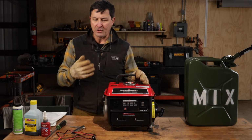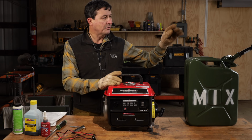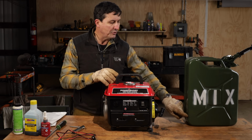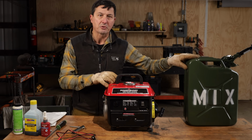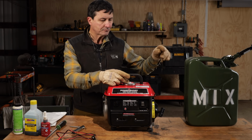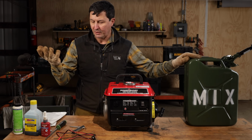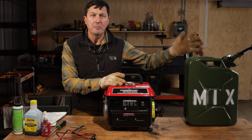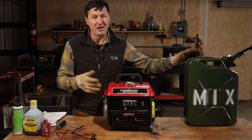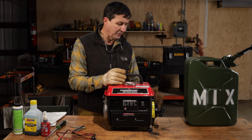What I'm actually thinking, rather than doing the kerosene heater down at the well pump when the power goes off to keep the wellhead from freezing, what I might do is take one of these Wavian cans. Maybe I'll do a video on it. I can show you how to put in a bulkhead fitting like we do in the wildland fires. We actually use similar cans to this as external cans. So what you could essentially do is tap the cap or the side of the tank and the can, and have a 5-gallon reserve tank, and that's going to run, well, 5 times, that's 25 hours. So that would basically give you a 24-hour run time on 5 gallons of gas. Not super efficient, but in an emergency, it's better to use 5 gallons of gas than have a frozen wellhead, right?